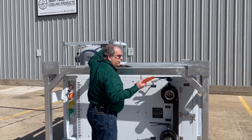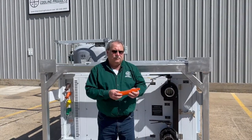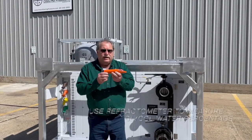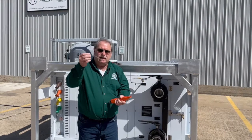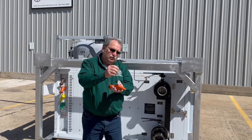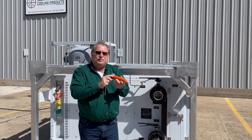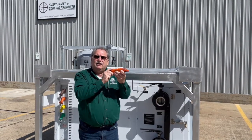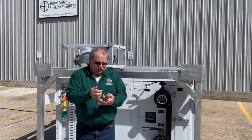Then you're going to use a tool like this — a refractometer. You can get one at automotive repair suppliers or online through Amazon. The way you use it is: get a small sample of the glycol, use the little dropper to suck some up, open the small window, place a drop or two on the prism area, and close it. Hold it up to light and look through it — you'll see a scale with a shadow line. Reading carefully tells you the percent concentration, and using that along with the freeze point chart will tell you exactly where your freeze point is.